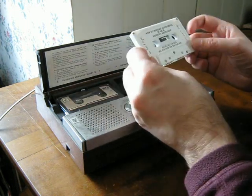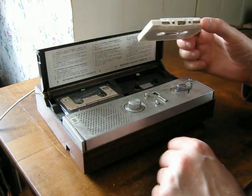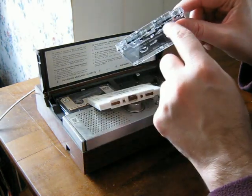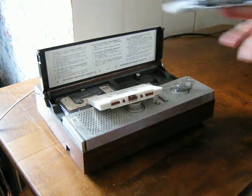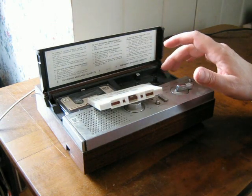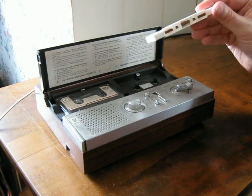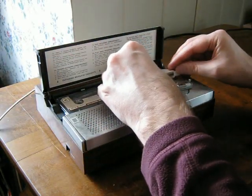One sort of weird thing about this is that tape cassettes normally have a lead tape — like there's a little bit of plastic tape and after that goes through, then there's the magnetic tape. You can't use that sort of cassette with this machine, because on the message tape it starts recording immediately. I actually had to take this apart and remove the lead tape so that it's all magnetic, otherwise your first message is missing the first ten seconds or so.